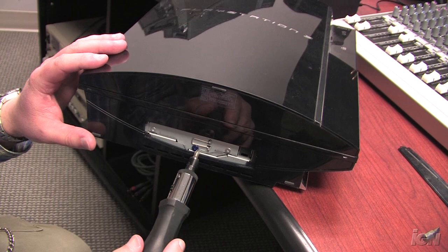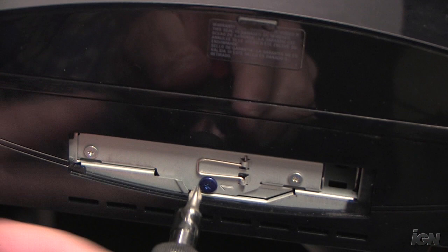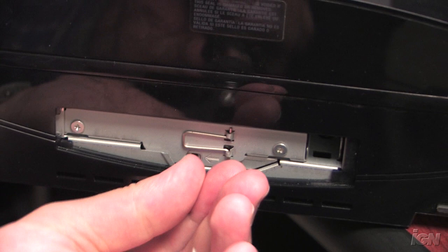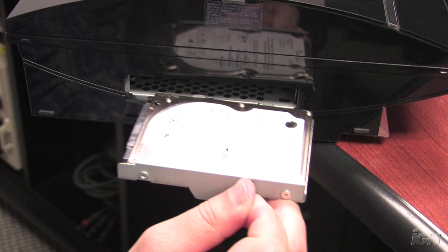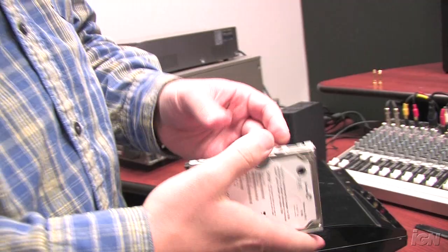The first thing you need to do is take a little Phillips head and unscrew this one blue screw here. Do it like this — comes out pretty easy. Then grab this little metal thing and the drive slides to the right before it comes out. So you'll see it comes over and then you just pull it straight out. And now you'll notice the connectors here — when the drive goes in, it actually connects to the side. So here's your drive. You've got two screws on each side, so you just unscrew these and then the drive comes out, put the new one in, screw that back on.